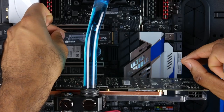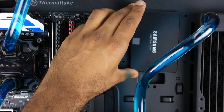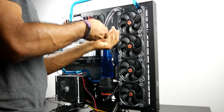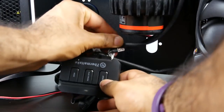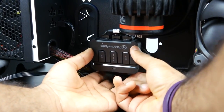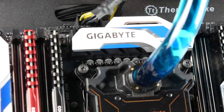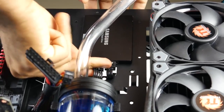We're going to install our M.2 drive onto the motherboard, and we're going to install our SSD drive onto the case. We're going to also install our LED fans onto the radiator, so we actually have some air flow onto that radiator, and we can therefore dissipate that heat much more efficiently. Luckily, we do also have a fan controller which will control our color parameters as well as speed, so we can run the system fairly quiet. And I'm going to attach this fan controller with some Velcro onto the bottom portion of the case, so things are pretty accessible there. Lastly, you can install all of your main power connections for your motherboard, CPU, GPU, etc., as well as connect all of your front panel connectors and supply your SSD with data and power.